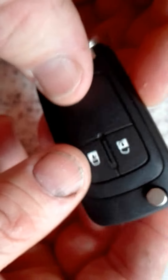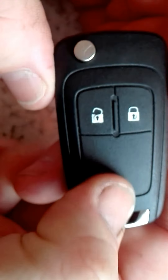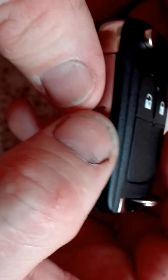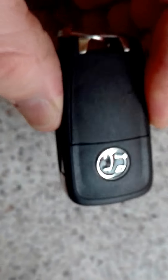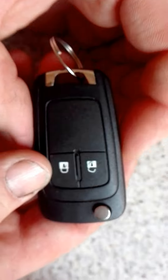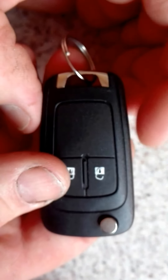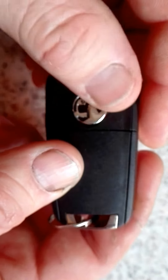If you've got a problem with the anti-theft warning system and the first part of my tutorial — taking the battery off — didn't work, then it's likely the key is damaged, the PCB has water ingress, or it's been tampered with or is a cheaper one on its way out. If you've got only one key, look on the internet for a locksmith who can reprogram and recut a new key as a spare — usually around £100 to £170 depending on whether the car can be moved. This one cost me £100 because my car was immobilized, but it's well worth it. I hope everybody gets some use out of this video — thanks for watching.